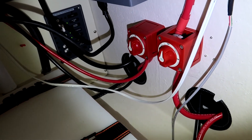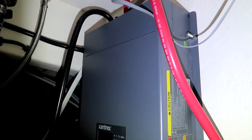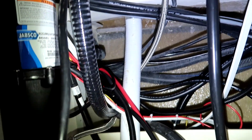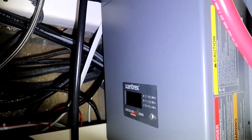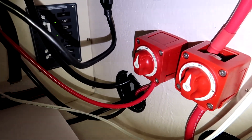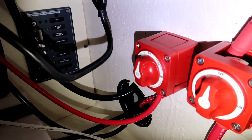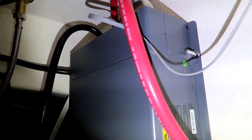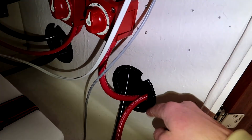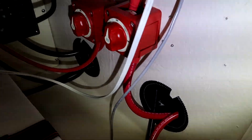So here's what you need: the black cable on the far left going across is a 1-aught cable — that's your chassis ground. I ran all my grounds over to a ground post in the corner. The cable coming down is your negative, going into a binding post directly to the battery. Then you have the positive, which goes to a switch — this will be my inverter on/off switch — and then that goes to the battery. You have to put the inverter on a switch.